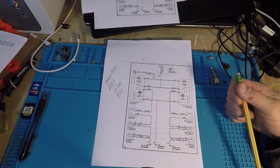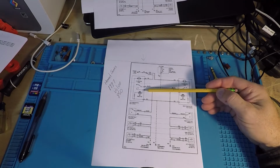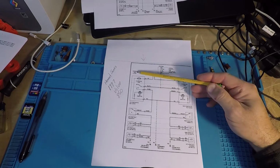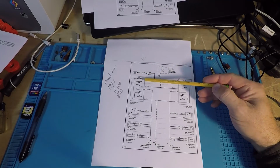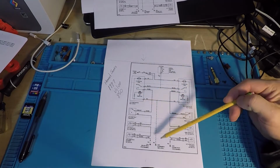So before we get too far off, this is the seat switch, the one you see on the center console. It has two lights. One is the illumination light right here. It's getting power from the interior light system. So you turn the interior lights off. Here it is, this wire, the power comes right to here. It comes down and over and down to this ground.